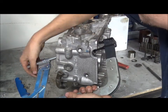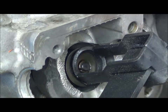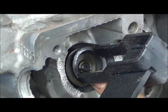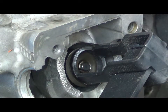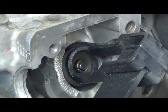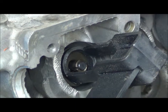So all you do is you tighten this up, and I'll try and get you in here so you can see. I've arranged this so I can do it and so you can see. This ring is clamped against the spring retainer, and the valve and the collets are sat in the middle. As you tighten this up — this is why it should be an Acme thread and not a V-thread, because you can feel it binding — it's slowly compressing the spring down. That's easily enough.